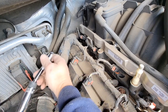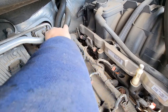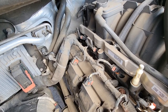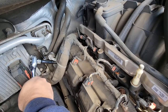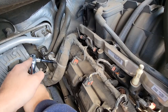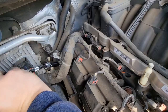Now in order to take the spark plug out, we've got our swivel spark plug socket - go right down the hole. Then I need another 3/8 ratchet, stick that in there, use another 3/8 extension, and then you can get your ratchet on there and get it loose. It comes out nice and easy.